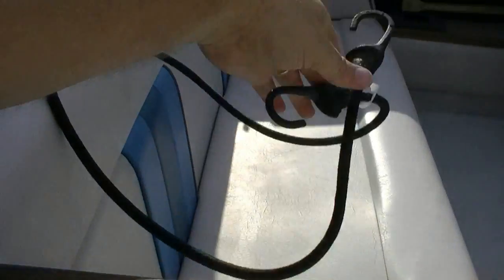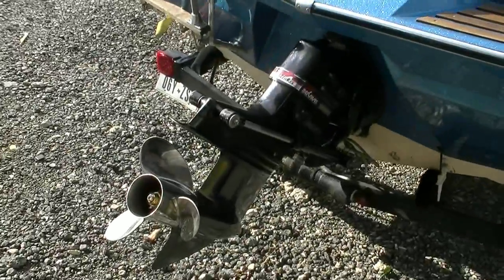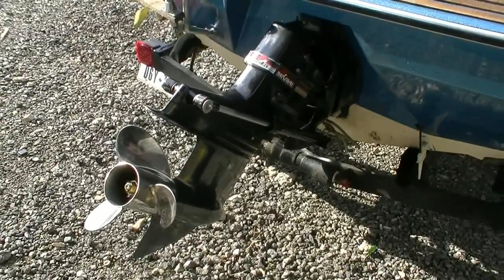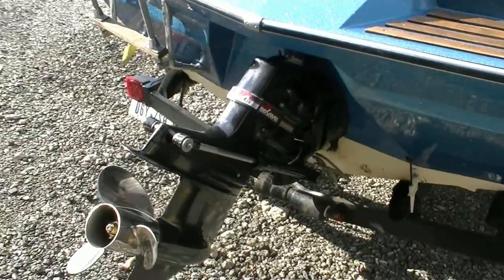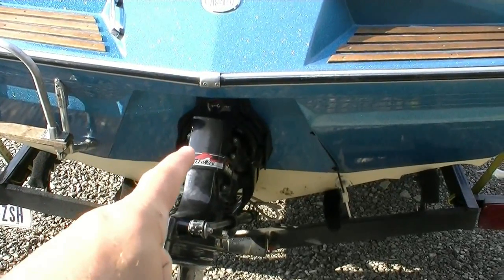The restoration is also documented on YouTube and iBoats.com — the link will be provided in the auction. The outdrive was completely refurbished; it hasn't been rebuilt, but it's been refurbished with paint and stickers, and it doesn't get any water in there. I just changed the gear oil today and the seals are still good. We did the gimbal bearing when we replaced it and had a new bellows in the summer of 2010.